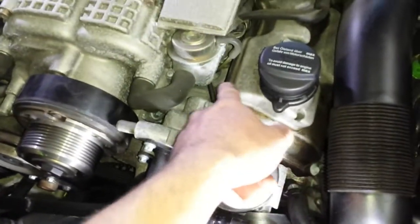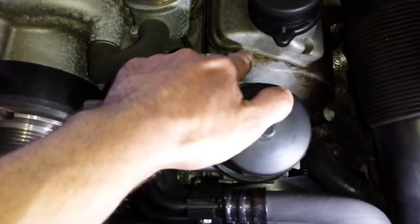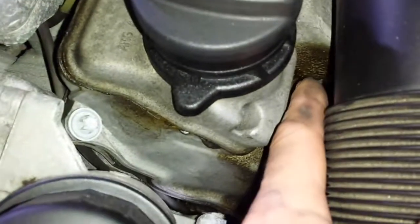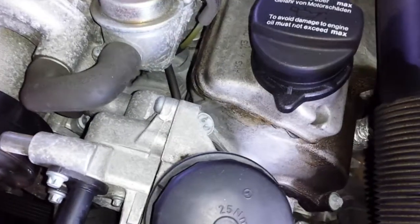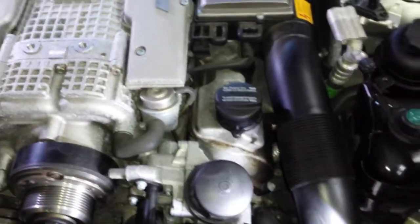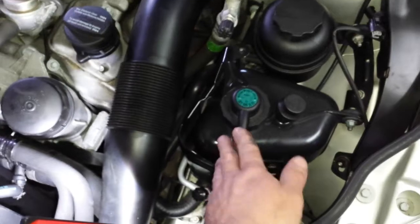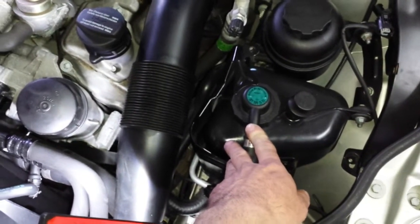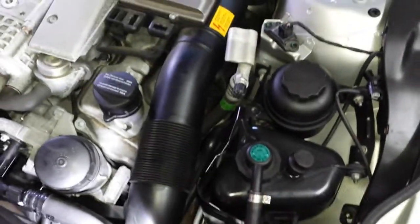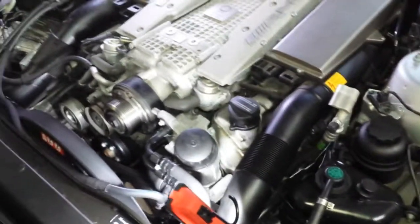There are also some oil leaks around the positive crankcase ventilation gaskets — well, there are no actual gaskets, they're just silicone — so that's a common thing on these cars. You've got oil seepage all over; it's not a deal breaker but something you want to repair so you don't have oil smell everywhere. Also the hydraulic situation — you want to change the filter and flush the system. That will be done after I fix the valve block, because the car is sinking on one side. I'm going to rebuild it and put new, better-material seals in it.